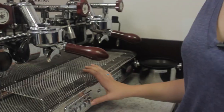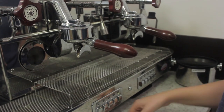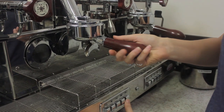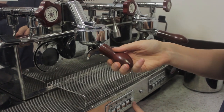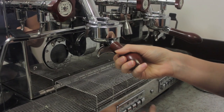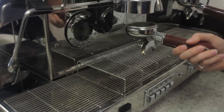Click on manual brewing, count out to ten seconds — eight, nine, ten — stop it, let it breathe for a second, go into it again for the second round, and for the last time do it once more. Once you do that, you want to be careful — you can use a cloth to protect your hands. Loosen the portafilter just slightly, engage the water, and just wiggle it so it allows the water to move within the group head. You're going to see that some of that dirty water just comes out. Unlock it slightly, engage your brewing, and let it wiggle just a little bit, taking care not to burn yourself.